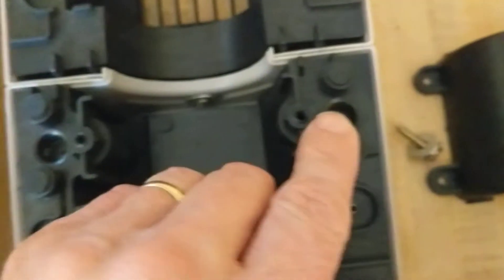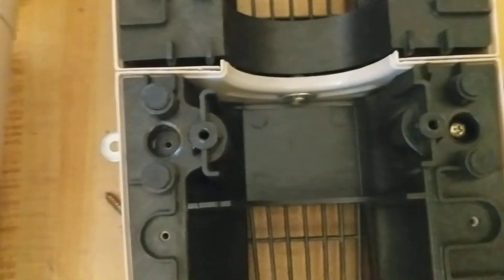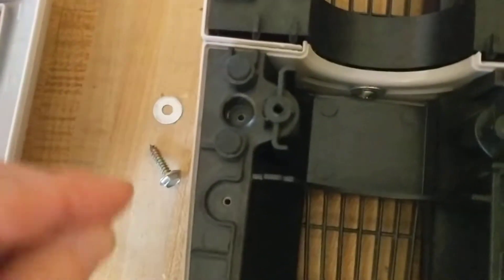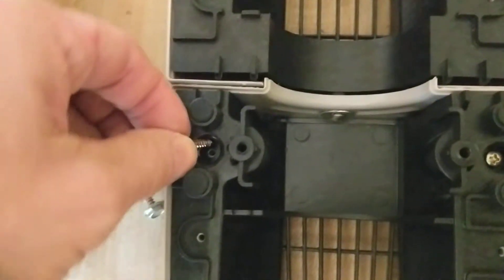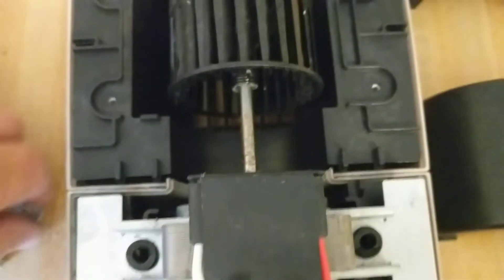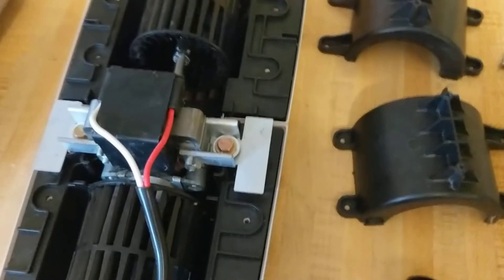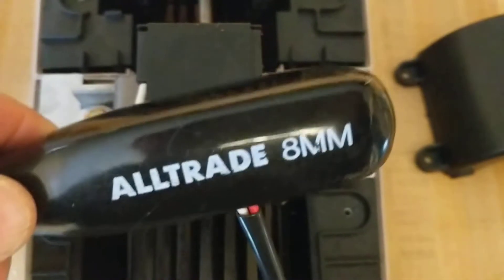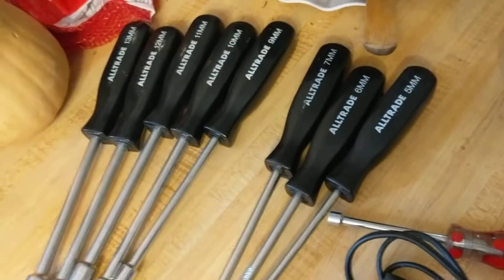First step: I put the plastic parts back in. This one takes one screw — it looks like it would take two, but when I took it apart there was only one screw here, and the other one is over here. Then I put the motor with the blade and squirrel cage assembly in and bolt it in place. It's an 8-millimeter; I'm using one of the hex drivers I inherited to tighten that down.